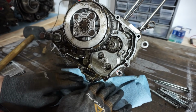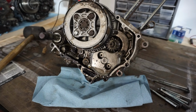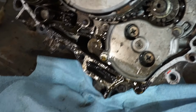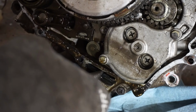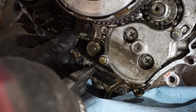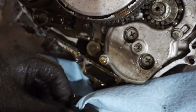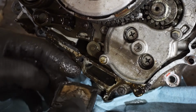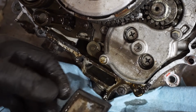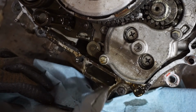That oil soaked up. So there's a little oil screen on this thing right here. Zoom into there. Let's just take that out and see what that looks like, if we can without ripping it. There we go. She's a little rough. Not really too many metal chunks though. That's a good sign. But you can see all the rust in there. It's just like cake.